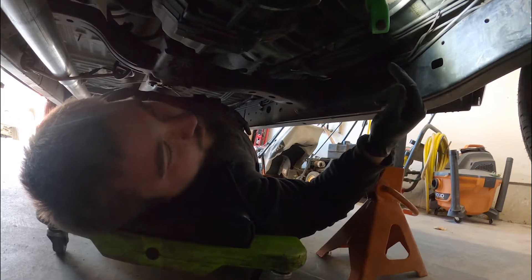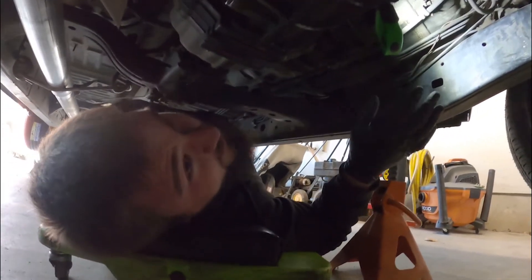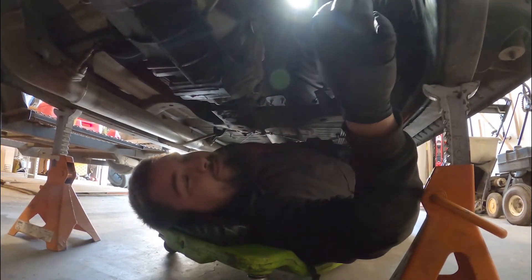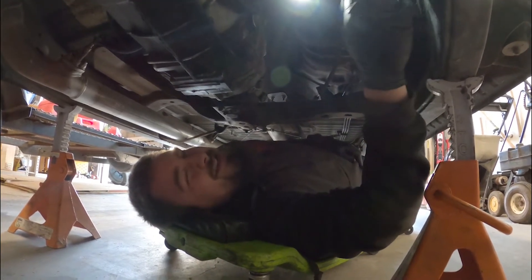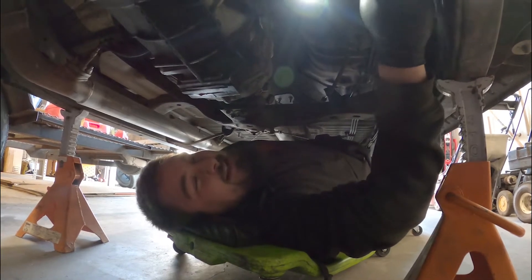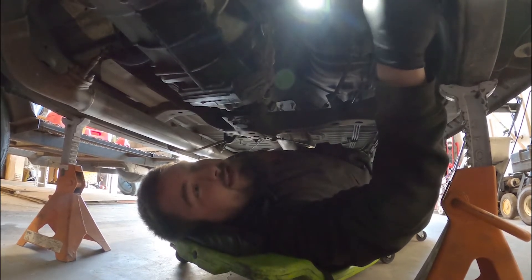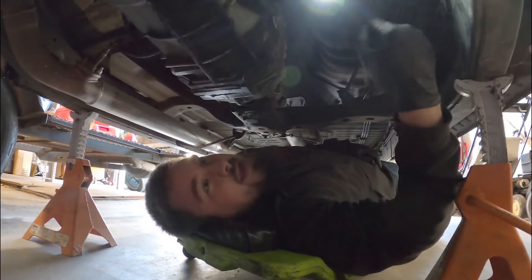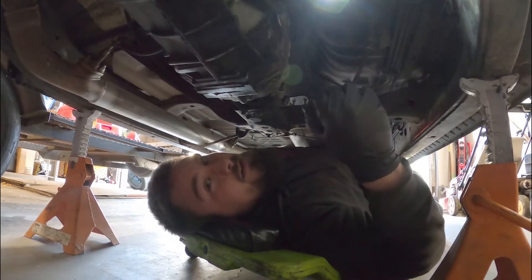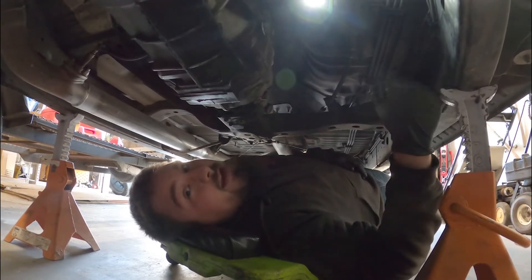But we degenerates are going to eliminate this line right here. I thought it was gonna be quite complicated, however, if this works the way I believe it works - going off of SWAG, which is a silly wild-ass guess but slightly educated - when I eliminate this line I should be able to put a plug in that block so no fluid comes out of it. No fluid will be going into it, and we'll still have the brake line running from the master cylinder back to the back, also eliminating that load sensor altogether. Because this truck's not meant to haul - it's meant to drift - so we need good braking power in the back at all times.